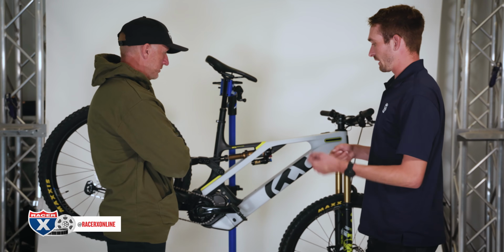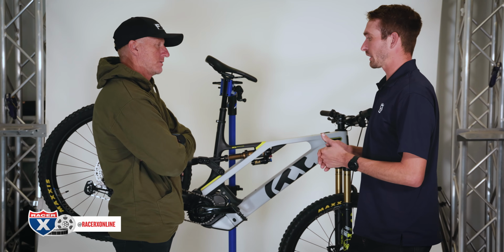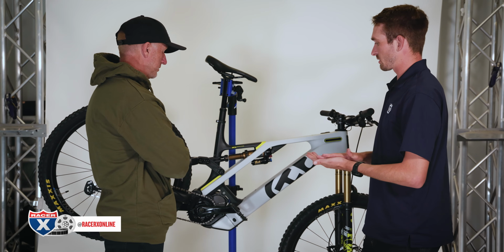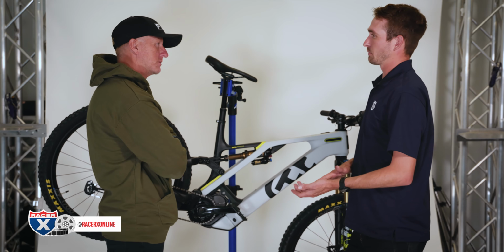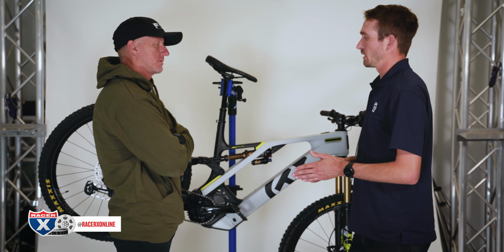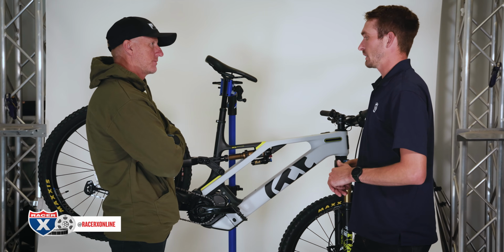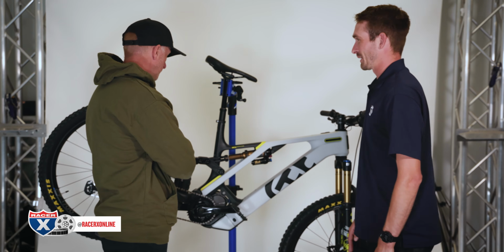Definitely, I make sure all the plugs are plugged before I go in and wash my bike. Just be careful. Definitely no pressure washer. Hose is totally fine. Soap's fine. One thing with mountain bikes, not like dirt bikes, the brake pads and rotors definitely get contaminated pretty easily. So be careful when moving the chain or spraying any sort of soap near the rotors. It's easier to contaminate a rotor, I think, than on a motorcycle.